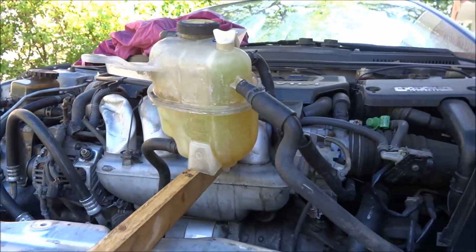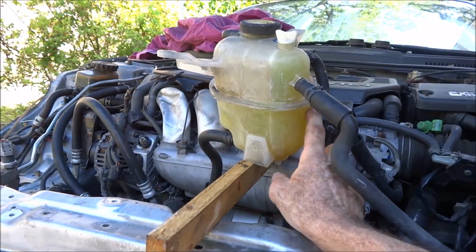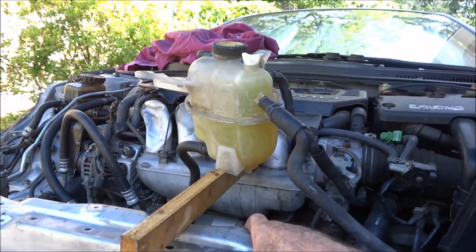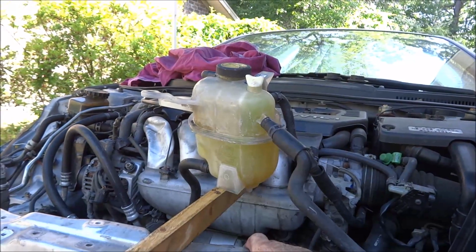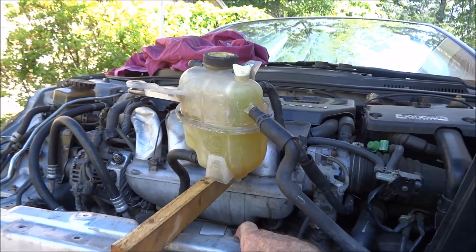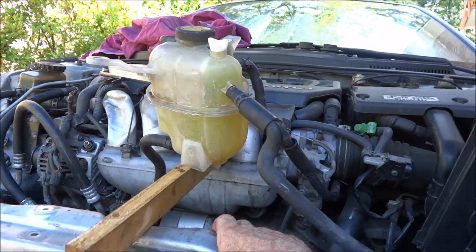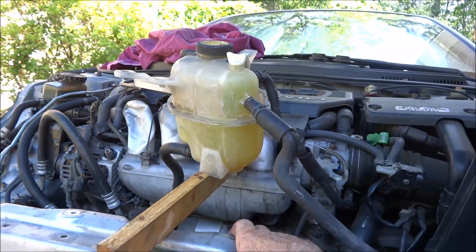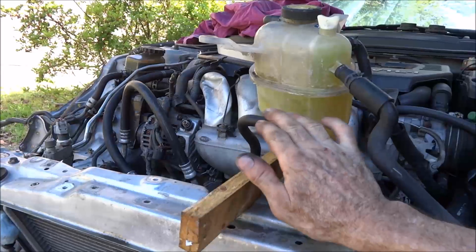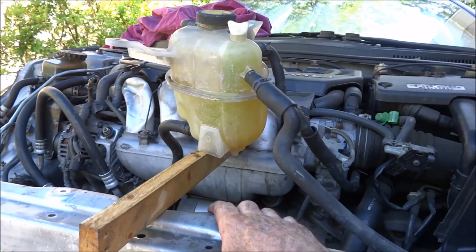I know this because I bought one and somebody had tried to run it, and I noticed there was coolant in it, but I also noticed the radiator was broken. And when I put a new radiator in it, or another radiator that I had, and got it all filled up, it was blowing bubbles bad. So it's, you know, warped the head because it was ran. Like I said, these will keep water in them even if the radiator is busted. I don't know why, but they do.